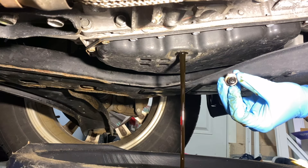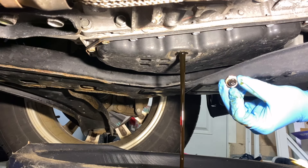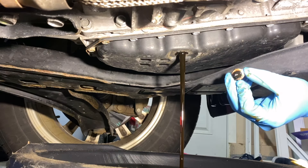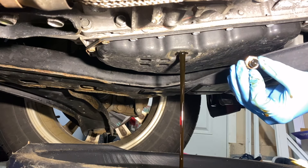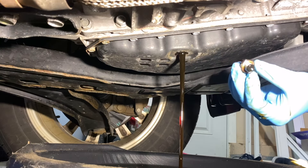While this is draining, I'll show a specific call-out: there is a copper washer. This is standard practice for Nissan. I'm going to use a copper washer going back on this. If you have copper washers already for your oil drain, it might be the same thread size.